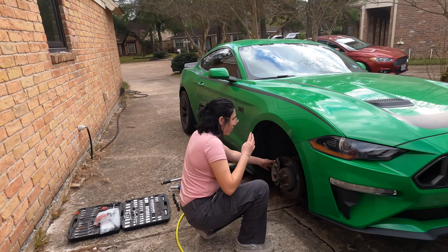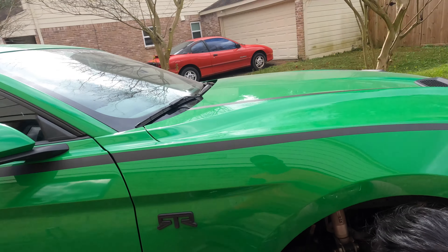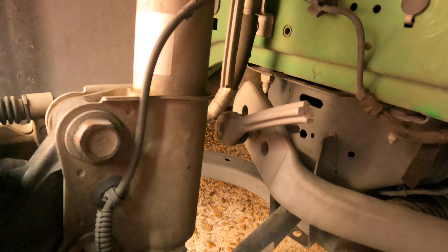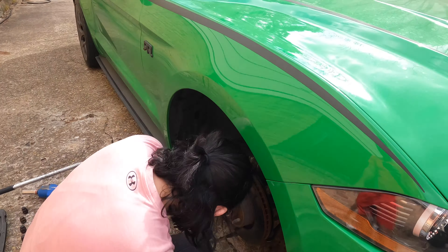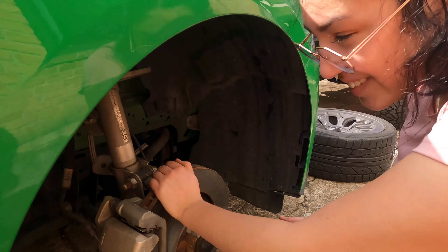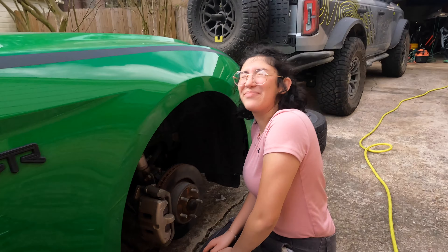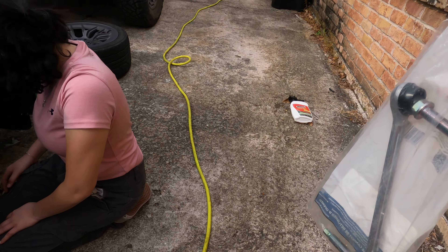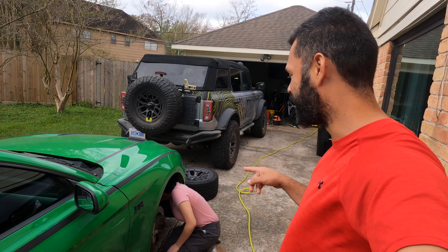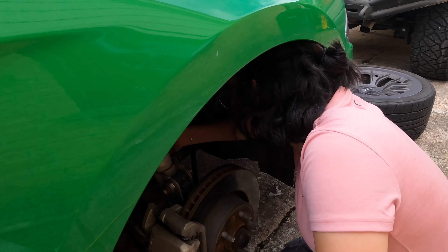She figured it out, but the mechanic said it was her passenger side. Nothing looks broken at first glance, but actually right here this whole thing is just busted and dangling. One of the many things Gabby did when she went into the ditch — it was segment 13 — was break her tie rod end. So she's been driving around for a while with a busted tie rod end.